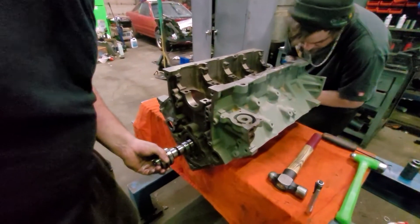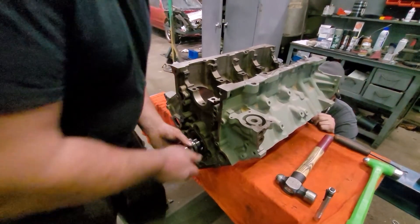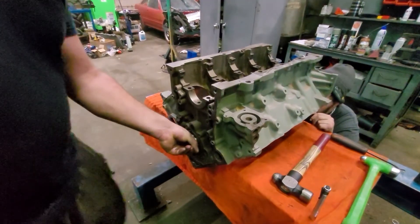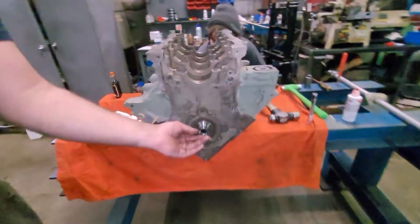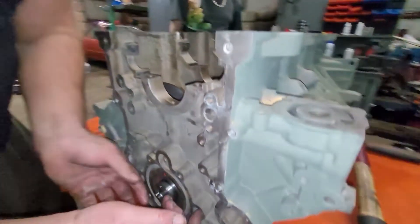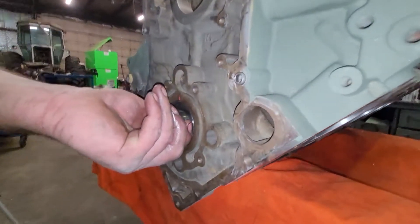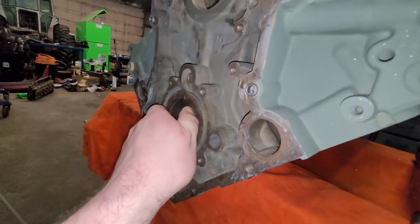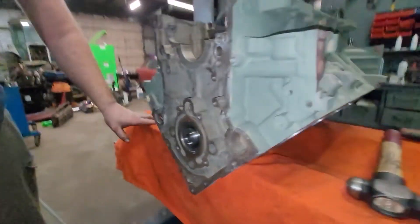Okay, let's slip it up. There we go. Alrighty, last journal here, up we go. And now when you go in there, this one turned out to be a pretty decent fit. What I look for is sometimes you might have a small burr or something like that, but you should be able to turn it by hand. You get it up to a spot where you can actually get a grip on it, sometimes it'll be a dowel or something. Give her a little bit of a turn - and I can turn that cam by hand. So that's an acceptable bearing fit - very easily by hand. That means we actually did it right this time and we should be good to continue.